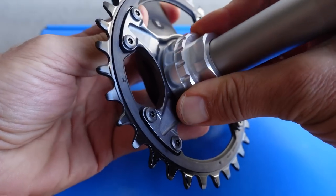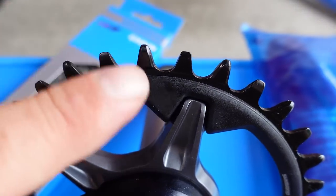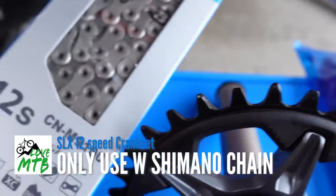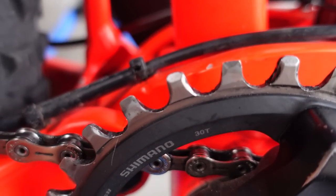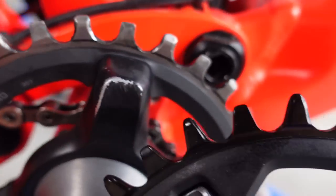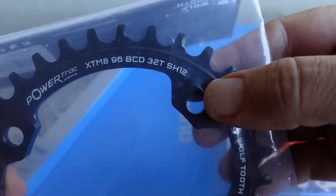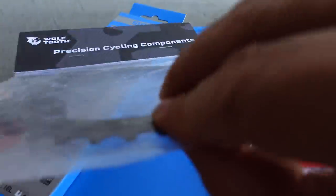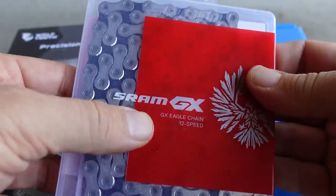I was told that XT and XTR cranks already come with the tool. The Shimano narrow-wide tooth profile was changed again — it's machined a bit more so these teeth are skinnier to accommodate the special chain that their Hyperglide Plus requires. In comparison, if you look at the old 11-speed chainring, the teeth are just wide and big. If you look at third-party chainrings for Shimano 12-speed drivetrains, they will highly suggest using Shimano chains, otherwise because of the skinnier tooth profile you won't have proper chain retention with something like a SRAM Eagle chain.